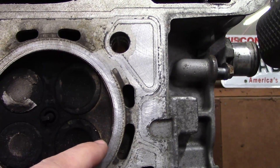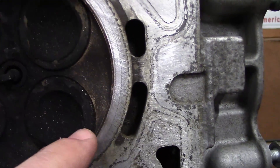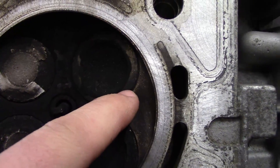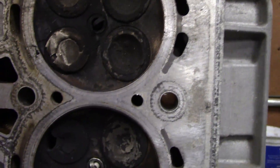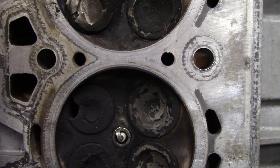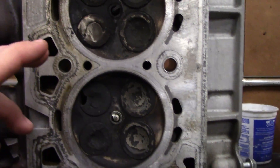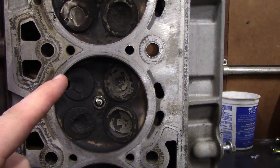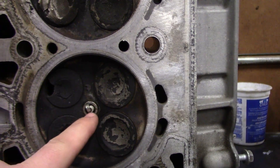We did a compression test on this one, and it actually turned out really good beforehand. You can actually see the voids in between the valve and the seat here where it wasn't sealing right. However, its detrimental failure was this cracked exhaust valve, which is not normal but does happen. When the car got brought to me and I did the compression test, it had zero compression in this cylinder. You can see this new spark plug here — that's because we were trying to diagnose what the problem was.